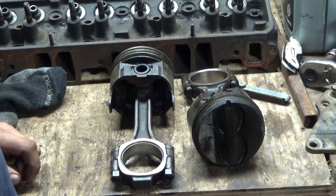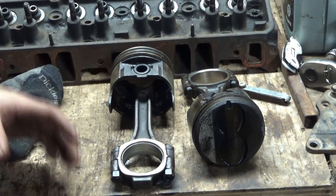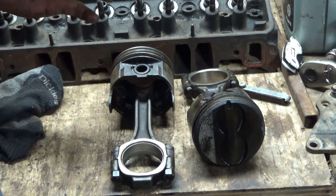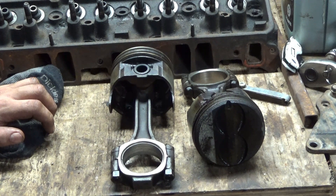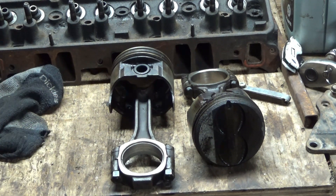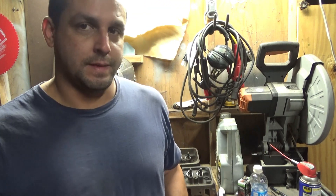The whole reason I got this other motor that I'm taking apart was because I was hoping to use a whole rotating assembly that came from the factory together — I didn't want to mismatch any parts. But this is becoming a big waste of time. I would have been a lot better off if I had just taken that first engine and bought a set of rods and pistons for it and got it balanced, even though that would have been an extra three to five hundred bucks. Was all this actually worth the trouble? It's kind of not.